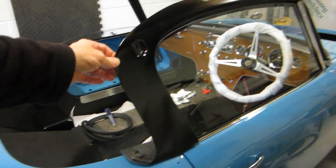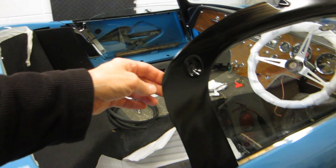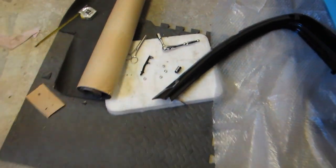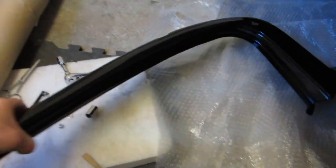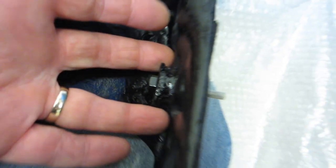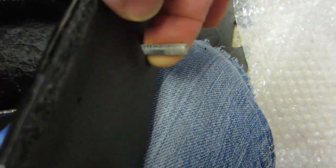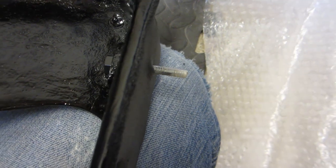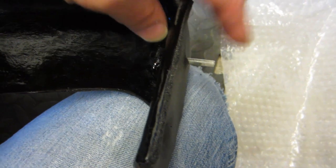I'm just starting to fit the cantrails. I've got this one around the door. The other one I've got here — in the back edge of it there is a bobbin. There's a threaded bobbin in the bottom which has got a screw through it, which protrudes through the bottom and it's got a plastic sleeve over the thread, about five millimetre diameter outside of that. That locates in a hole on the body, which I'll show you in a moment.